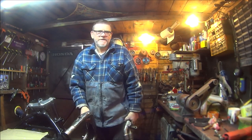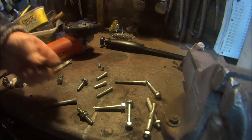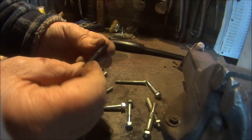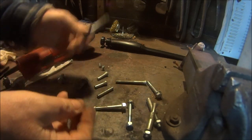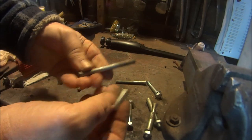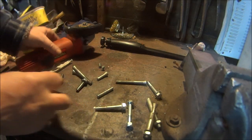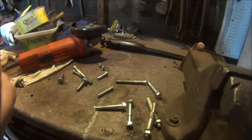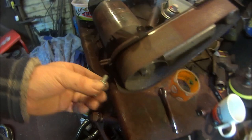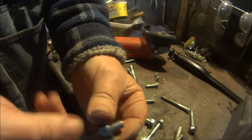How you all doing? So what we're getting up to in this video - we're fitting the exhausts. The first thing I've done is these are the original exhaust studs. I've got quite a few of these in my collection and they're the same thread, so I just cut them down to size with the angle grinder, going on the rotating sander, just moved all the threads off.